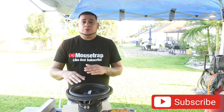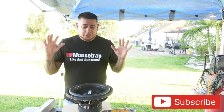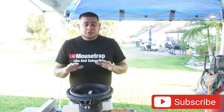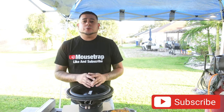You'll get good bass response from it — you'll get some nice low notes and some nice high notes because it's in the trunk and it's just building pressure in there. You're not hearing the cone noise from the sub, but it is producing some really good bass that you will be happy with. So you need one cubic foot for your subwoofer enclosure, but how do you figure it out? Let's get on the iPad and I'm going to show you real quick.